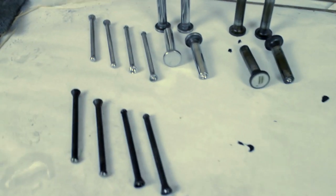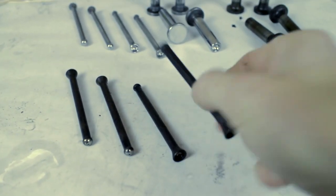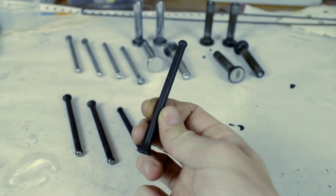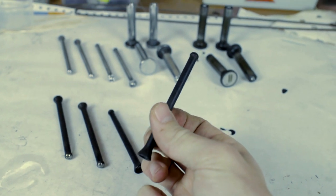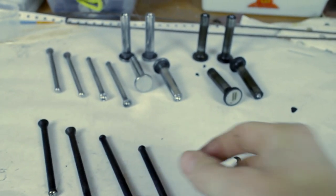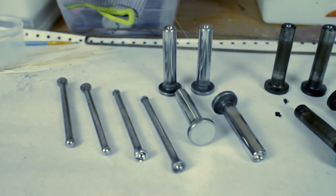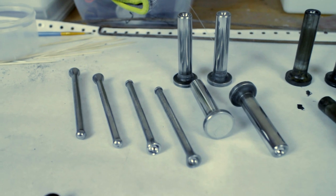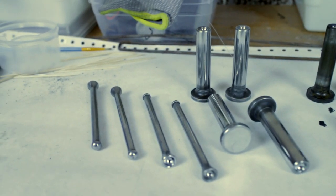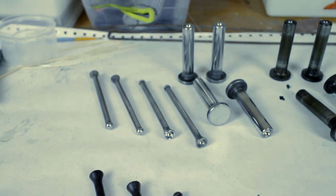As you can see I've already cleaned all of these. You can see that the pushrods are very dirty and a little bit rusty. They are full of caked on oil, and this is how they look once they are cleaned. Once they are all cleaned we're going to test them for straightness and to see if they need a little bit of work at the machine shop.